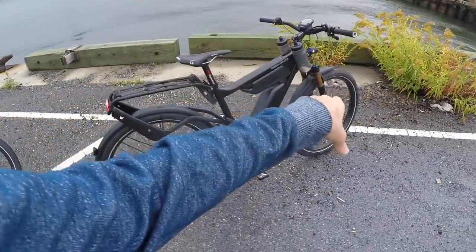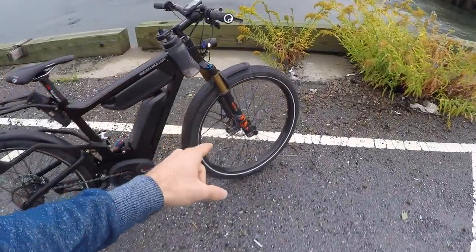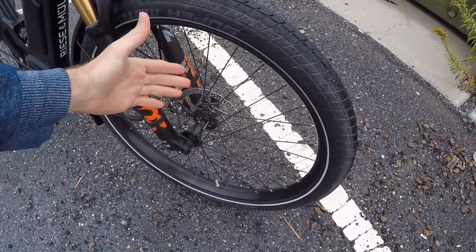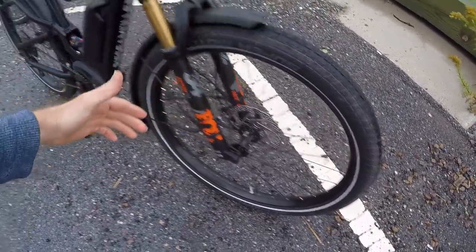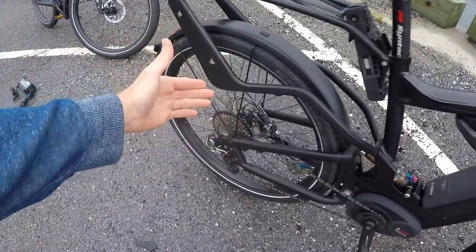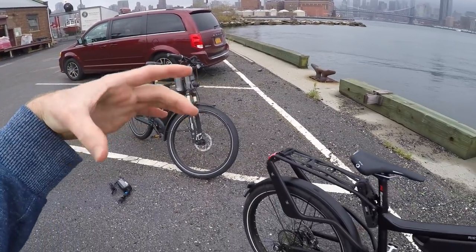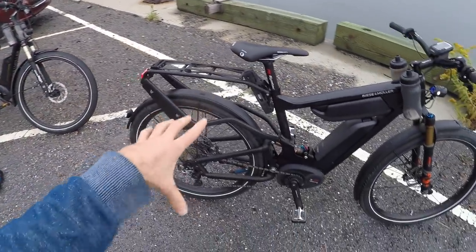It was really surprising because when I was doing the specs for this, I realized, wow, this has a Boost hub, a little bit longer. Instead of 100 millimeters, it's 110. And in the rear, instead of 142, it's 148. And in fact, I think the original back here has 135. So those spacings, they all matter. This is like a mountain bike setup here.